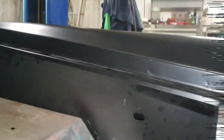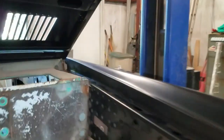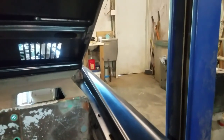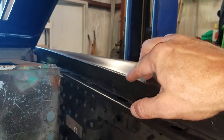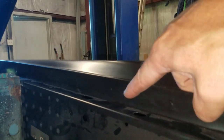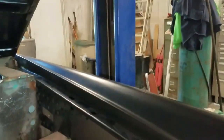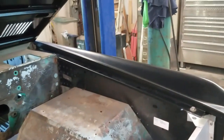Let me open the hood up and I'll show you another spot. Here's the other issue. We put in a new apron. Can you see the gap there? That's the gap. All this is put back to the original height of the Bronco, and to me this edge here is just too tight. Luckily when they form this thing, it's basically an L-piece of steel that goes up inside the fender and they spot weld it together. So what I'm going to have to do is drill these spot welds out to make this fit right.